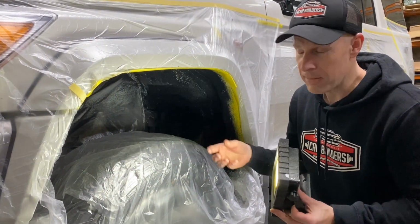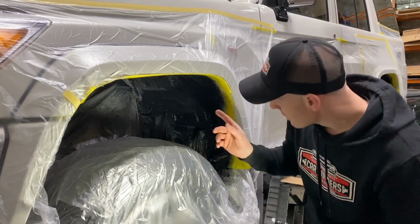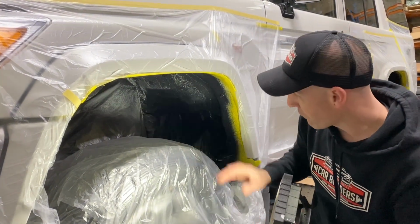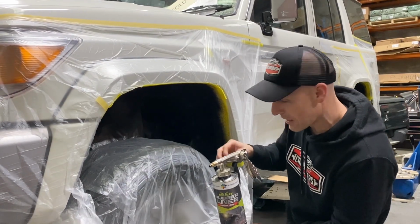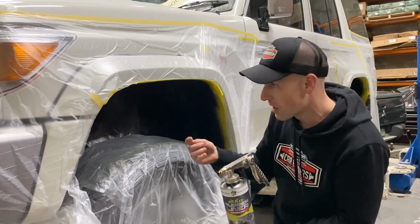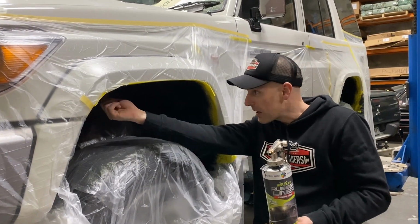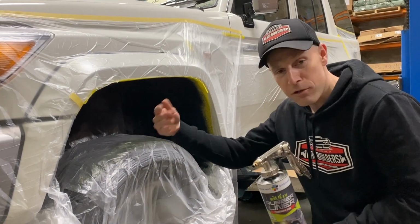If you don't have the time, you can come back the next day and paint straight over. It'll stick, you don't need to touch it. So we'll blow those in. We'll let it flash off and we'll come back and we'll put the second coat on. If you do miss bits though, you can just dip in a brush or decant this and just brush in and get those hard to reach bits, which there will be some back faces on back of these bolts and everything that I haven't been able to get. But use your torch, get under and just brush them in.